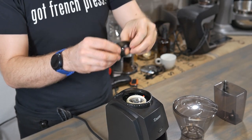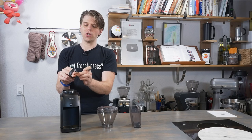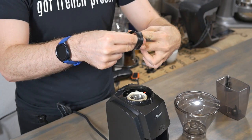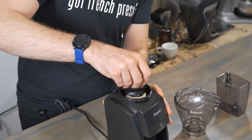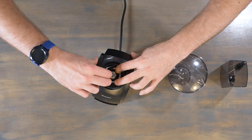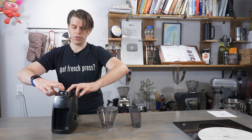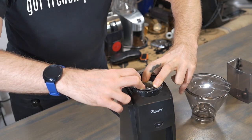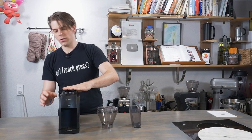Here's the second method without having to take that inner burr out. We're going to do roughly the same thing — just kind of stretch out the gasket a little bit. Remember, if it's new, it's not going to be as malleable, so you'll have to stretch it a little bit. I like to start on the little red wing right there because it's a good target. Place it there on the red one, then take your fingers and expand this out just a little bit. Using your left hand to hold this gasket part down as best you can to keep it in place, stretch and then slide over the other wing of the inner burr. Now it's in place and it should stay.